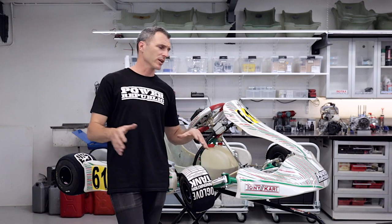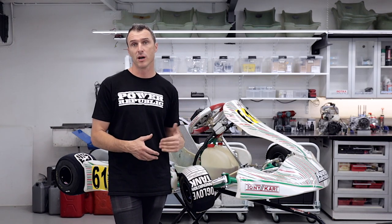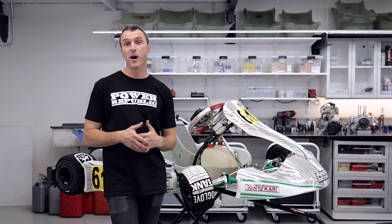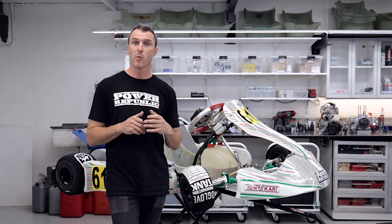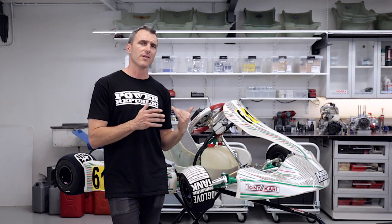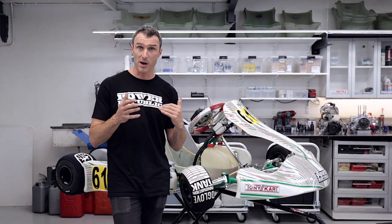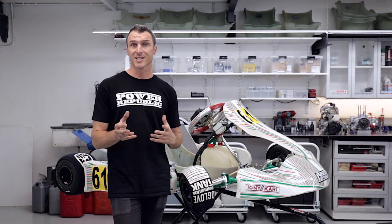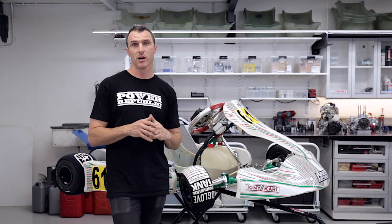Over the last couple of weeks we've been fielding a lot of questions about karting, and one that keeps coming up is how to scale and weight your go-kart for optimum performance. We've got a Tony Kart here and four bathroom scales. You can use the fancy Longacre digital corner weight scales, which is probably optimum, but most guys aren't going to have the resources for that at home, so we've grabbed some cheap bathroom scales from the local shops. We're going to show you how to position them under the wheels, take down the measurements, and then start adding lead ballast around the kart to get the weight distribution just how we want it.